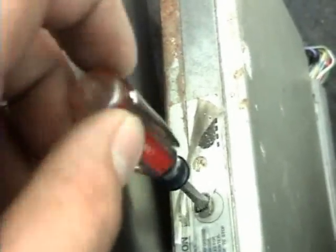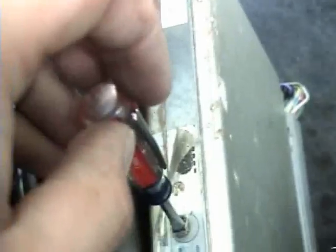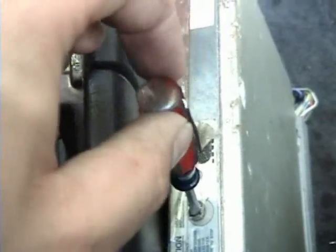To clear the codes, get back down to your ECU. Turn the screw to the right, leave it for two seconds, then turn it back to the left. Be very, very gentle — you don't want to break this. Just use two fingers and you'll feel when it stops. Don't force it, because you will be pissed off at yourself if you do.